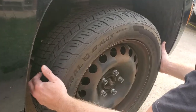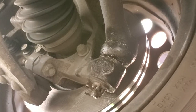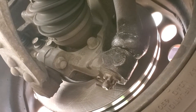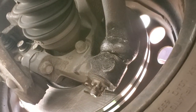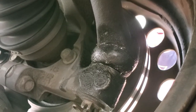So again, we're going to do nine and three — we can see the movement. Going underneath the car to take a look, the first thing we're looking at is the outer tie rod, which is right there. The outer tie rod has a cracked boot. I was going to use a tie rod replacement tool to pop it out and replace the boot, but then I started shaking it and realized things were looser than I thought. Grabbing it at nine and three and moving it back and forth, you can see and hear the tie rod moving right there.